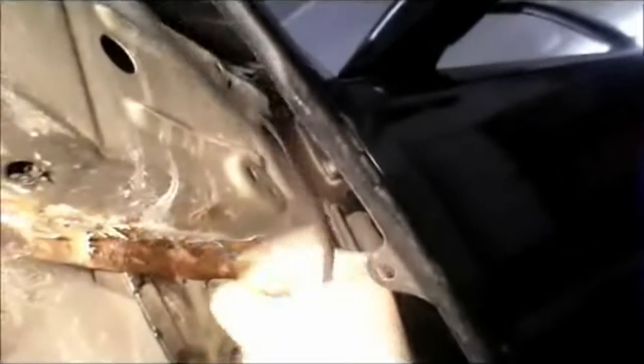After we have the cable pulled through here, we're going to get a pair of pliers and we're just going to pull this rubber grommet right here through so that it seals where it's supposed to be. Next thing we're going to do is we're going to reinstall those clips up in here that we previously took out. And then we're going to put this fender back together here. That's what the grommet is supposed to look like when it's pulled through. Next thing we're going to do is we're going to put these clips back on here that we previously took off.